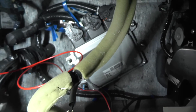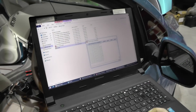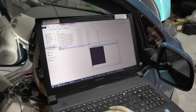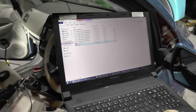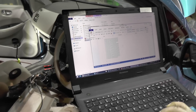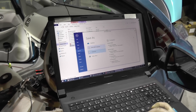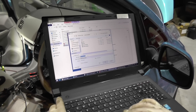We need to get it up in the air, get some logs off it, and fingers crossed everything will be okay. What we're doing here is reading the logs from the car with the new CAN bridge in, and then this data gets altered so we can reconfigure it for a 40 kilowatt hour pack. We originally flashed the firmware, then read what the car is saying, alter that, and reflash with the later software. It's not actually that difficult, just a little bit time consuming, but so far it's going okay.